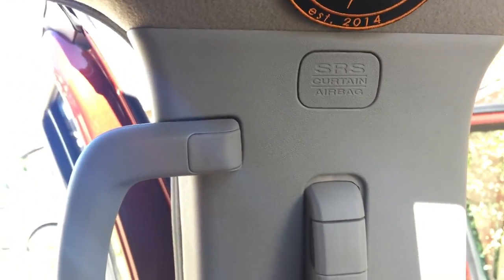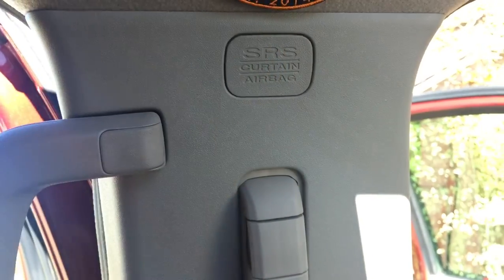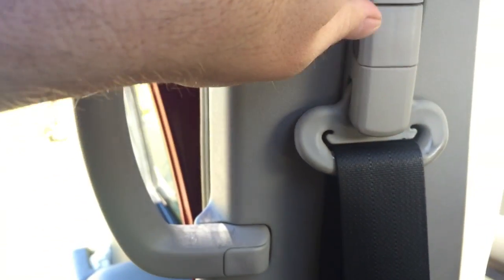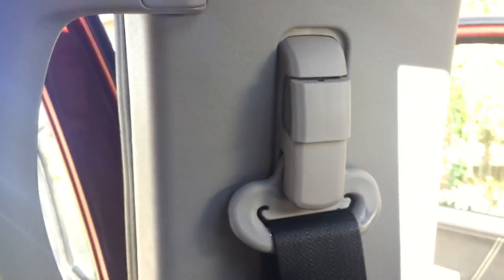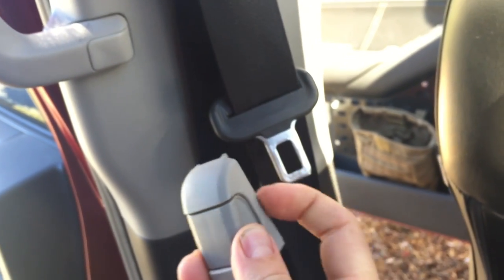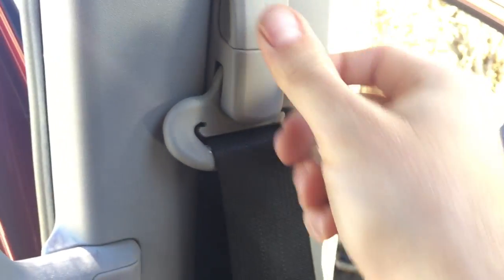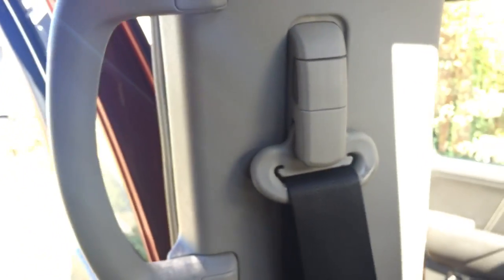To get the B-pillar off, go over to the other side. You're gonna pull — basically just pry that off. These two pry off and there's 10 millimeters behind each of the three of those. Also this pops out — it's basically this — you're just gonna pry it on each side and on the bottom. That just comes out; you just kind of start prying it out and it'll all pry out.